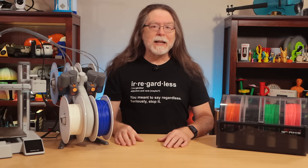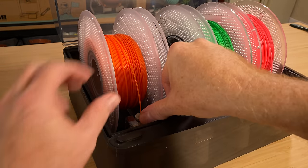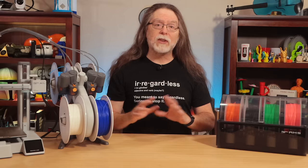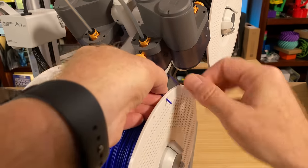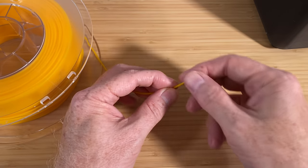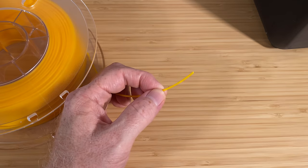So how do you prevent this from happening? It's actually quite simple. In the extremely unlikely event that you're not going to be using your printer for a few days, unload the filament. On the AMS, open the lid, press the filament release, pull the filament out of the feeder, and secure it to the spool. Same thing with the AMS Lite — press the filament release, remove the filament, and secure the end of the filament to the spool. When you're ready to print, bend the filament ends to see if they're going to snap. If they do, move further along the filament until it doesn't do that anymore, then load the filament again.